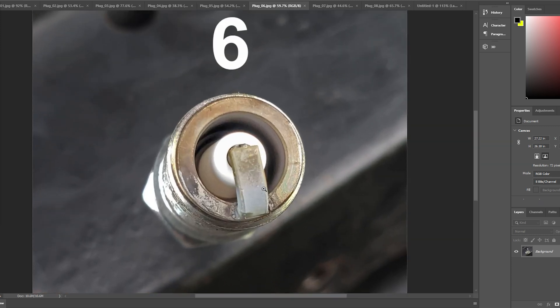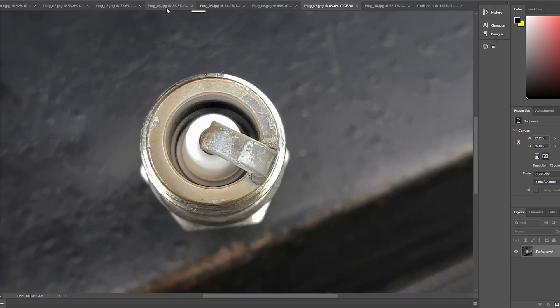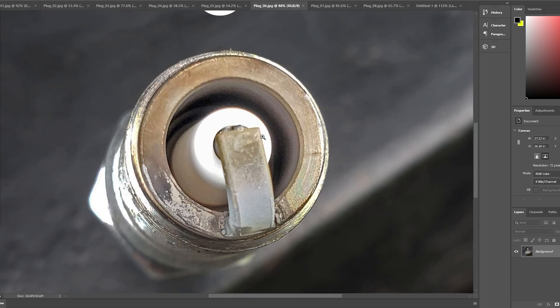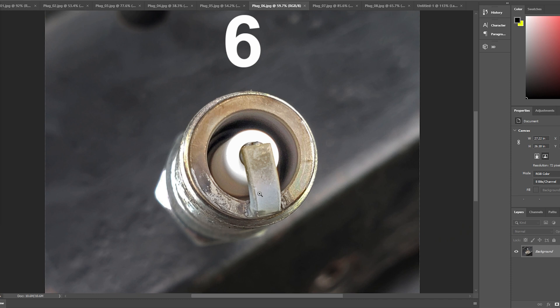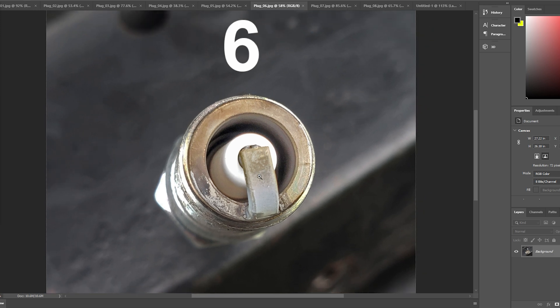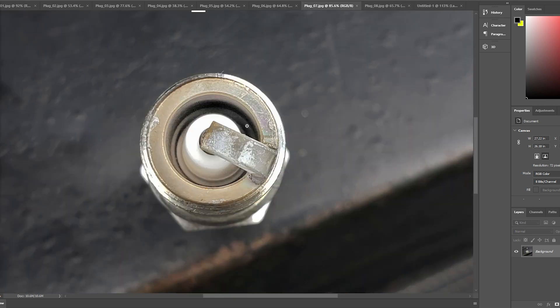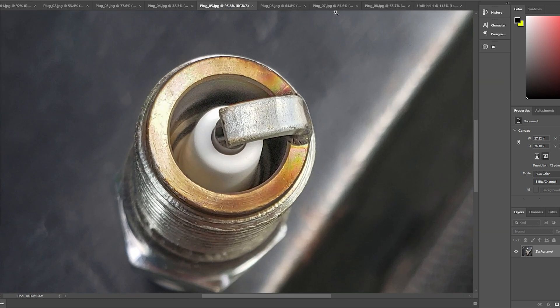Number six is the fattest plug out of all of them. You can tell because there's not a really defined timing mark here, as opposed to number four where it's very distinct. I think when you have more fuel in there it runs cooler in the combustion chamber. That said, you really don't want anything too fat on nitrous because you can hurt it just as bad — but I wouldn't call this too bad. With nitrous you always tune to your leanest cylinder and find that happy zone. Number seven is probably a little fatter than number five, which fires right next to it.